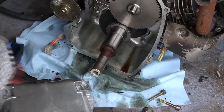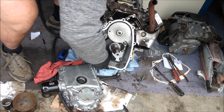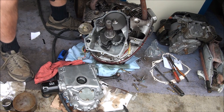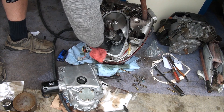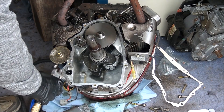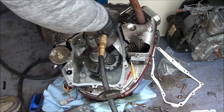At this point I'm going to turn the engine upside down — or almost upside down anyway. Make sure to clean out everything — there were a lot of little pieces of gasket that ended up in there. Clean off the gasket surface, make sure to clean out the threads. The gasket goes on dry — you don't have to put on any gasket sealant or anything like that. Perfect fit.